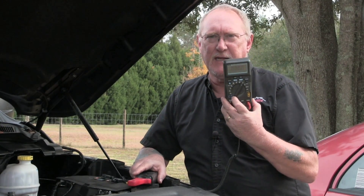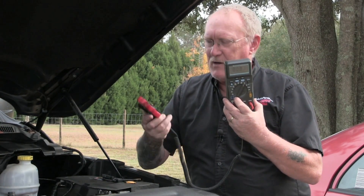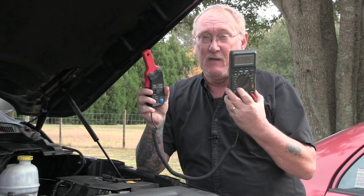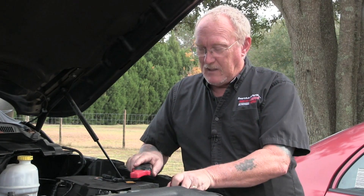So if that's the case, can't I use my digital multimeter in the amp mode, or better yet add a low amp clamp to it, or a scope, and use current as a tool to help me determine what kind of problem I'm dealing with and what might be the cause?